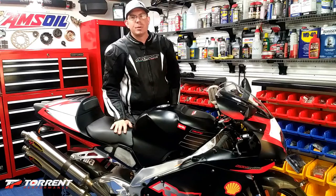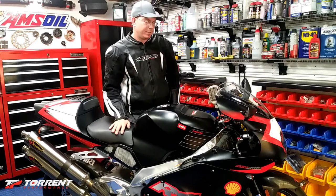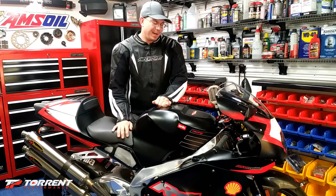Okay YouTube, this is Michael Bell back from Torrent Performance and we're getting toward the end of this mini series. I actually took this bike out and rode it today. Only had two issues with it. One, the speedometer didn't work. When I changed the rotor over to that Bob Moto steel rotor, the speedometer runs on the sensor on the back — they sent me aluminum bolts, so I put the original steel bolts back in the rear rotor and then the speedo sensor started picking up. And I had some issues with the front brakes where I thought I had them bled, went out and did a little rip, and guess what? No front brakes.